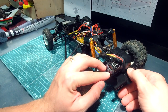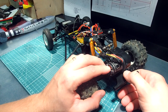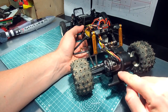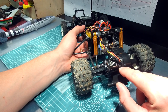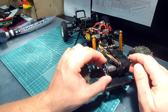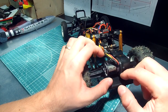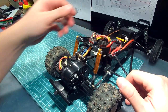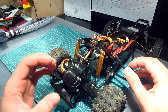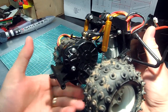This motor is exposed — I won't be riding it in very harsh conditions so I think it will be alright. Because these small airplane motors come with narrow hole spacing of 19mm while the stock motor uses 25mm, I printed a disc that converts the 19mm to 25mm so I can use this small motor and use the 18-tooth pinion which is stock for the Grasshopper, without using Tamiya's included adapter plate for the 380. It's 2200 KV — not very fast, but with the 18-tooth pinion it has nice torque.